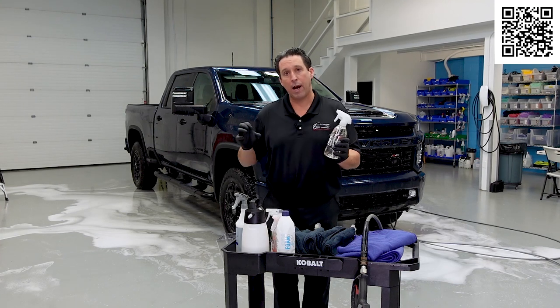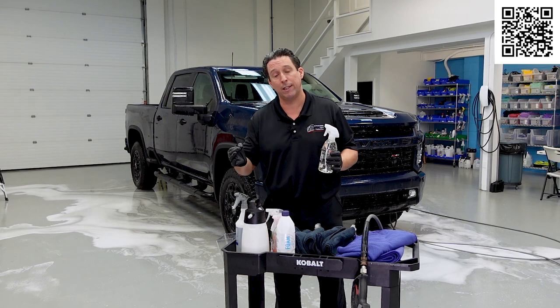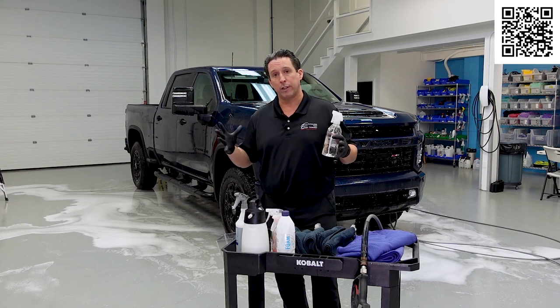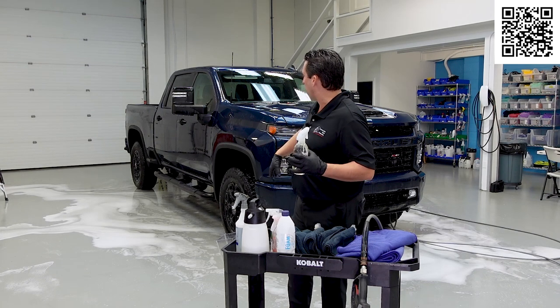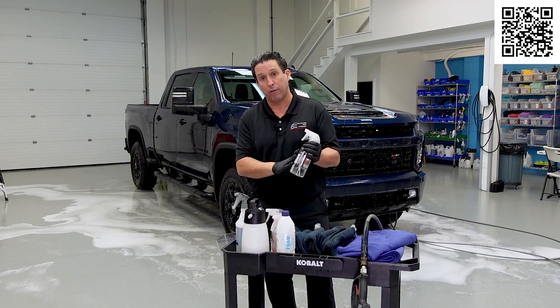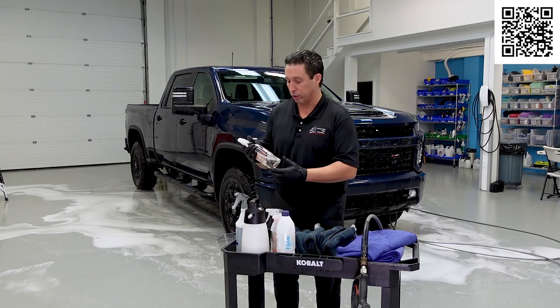The iron comes off the road from the trains, the steel wheels from the trains. When you apply the brakes, if the drums and the brake rotors are made from iron, from ferrous carbon steel, that's gonna get kicked up. Those particles are gonna land on the paint. They're gonna lay in the paint and embed into the paint. So the easiest way to get rid of them is to use Gyeon Iron. It's gonna dissolve those iron particles.